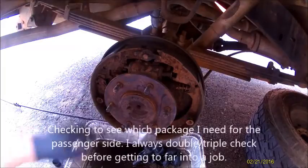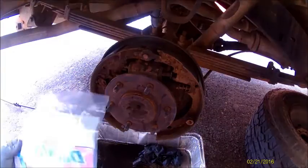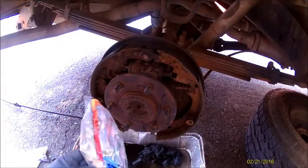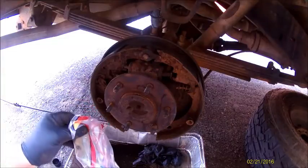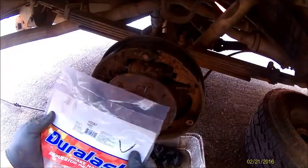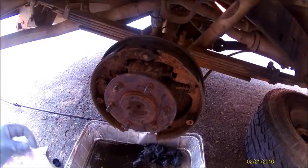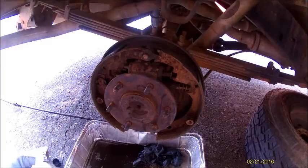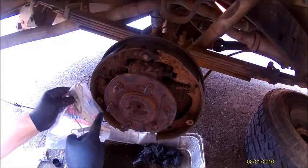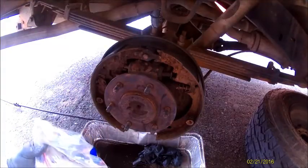This side, the lever adjuster, this piece is curved in. So it will be this kit that goes on. So from AutoZone, Duralast H2587, the guy over there labeled it as left, which typically means driver's side, which he clearly mislabeled, so you always want to double check your parts and pieces. The piece is going to go in there like this with the indentation towards the truck, and then the piece that holds it on will snap into here.